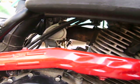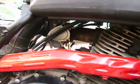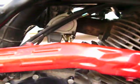It's me again. I just cleaned the carburetor — it's not as hard as it looks. What you have to do first is undo your throttle cable, which is right here. It screws off, so just unscrew it, then take these three screws here. That throttle cable goes through there and connects to this little thing up here — it has a little canal.